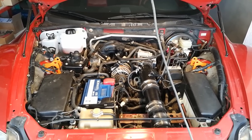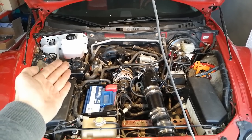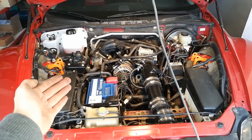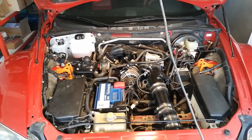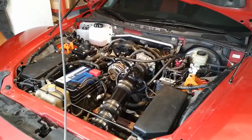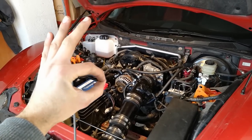A common question is: do I still have to premix after installing the Sohn adapter? Well, you've solved the problem of the oil type, not the quantity. So yes, I will continue to use my daily premix ratio. The link to the adapter and the tools will be in the description. Now you can finally ditch the mineral oil in your pan and go full synthetic. If you liked this video, give it a big like and hit the subscribe button so you won't miss out on the next episode.